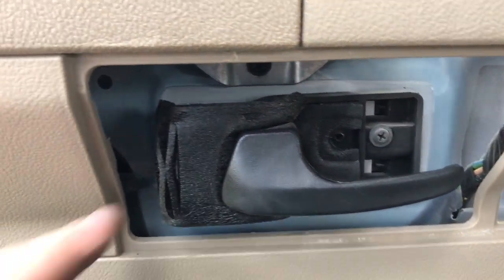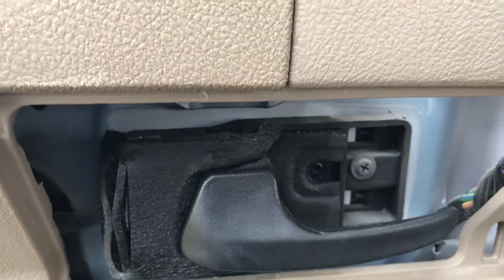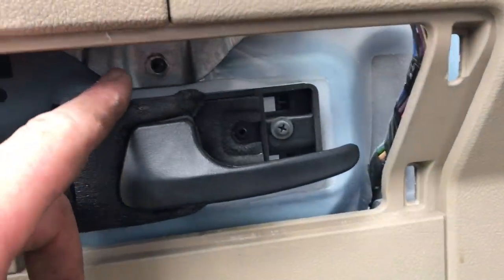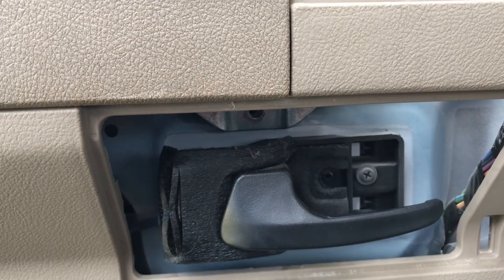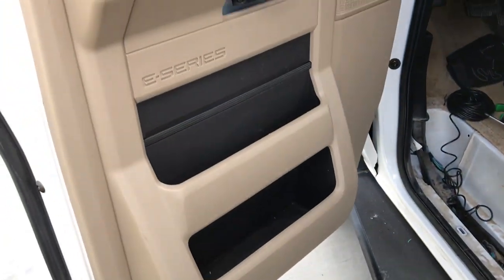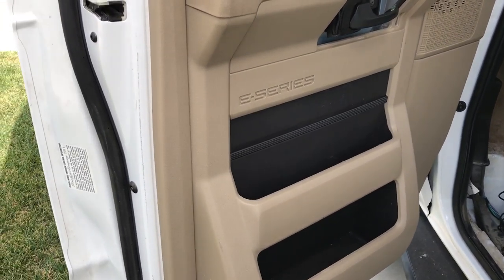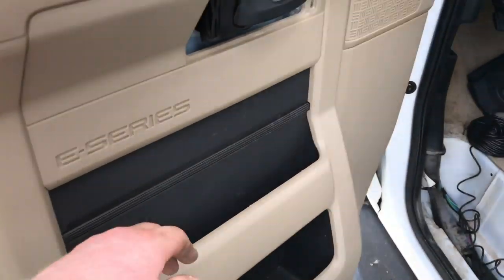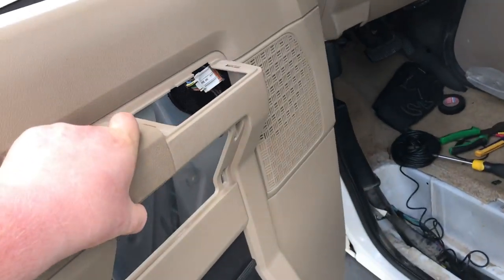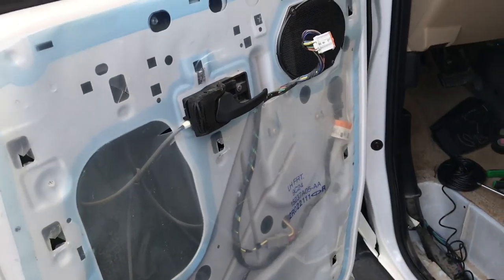Giving the space to clear the door handle. And then finally, once that's out of the way, you're going to notice there's going to be one more screw here — go ahead and take that one out. At this point, they're actually not clips, they're little tabs that hold the door on. All you have to do is lift, kind of give a little shake.